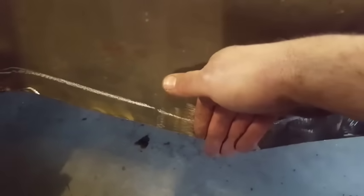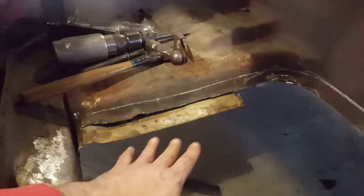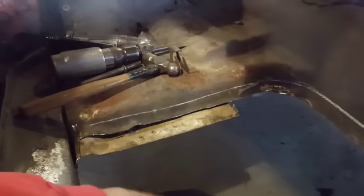I got this cut so it's a down plane, so when I lace the panel in, it's going to want to fall right to this panel here and fall right to this panel here. If you left a bit of a loop on the bottom side of it, you're going to be fighting that to drop it down. So it's best to be on a downward slope all the way along, even on the back side here, so the panel will want to fall all the way down. Here, here, and here are the only places it's going to want to rest. So I'm going to grind them up now and we'll test fit it.